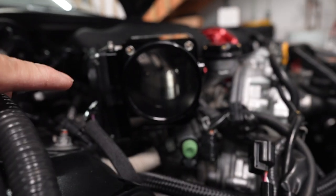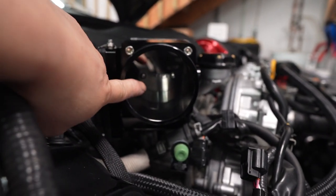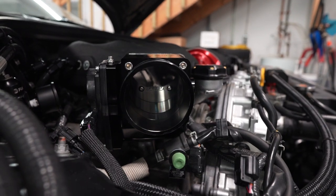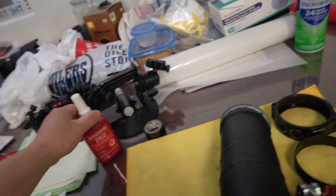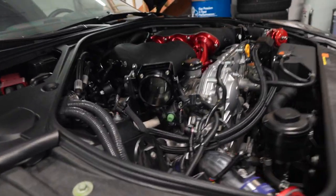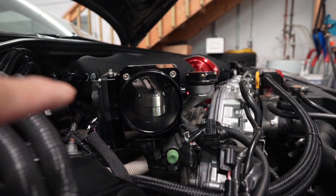The other thing they don't tell you in the instruction video is you need Loctite — on the two screws, you will need red Loctite. Because the last thing you need is those screws coming loose and going into your engine. When you go through the video it doesn't tell you that kind of stuff, it goes straight into switching over the internals and doesn't talk about the flap or anything. But their online instruction is actually a little better and it does tell you about Loctite and the butterfly flap, so you might have to jump back and forth.